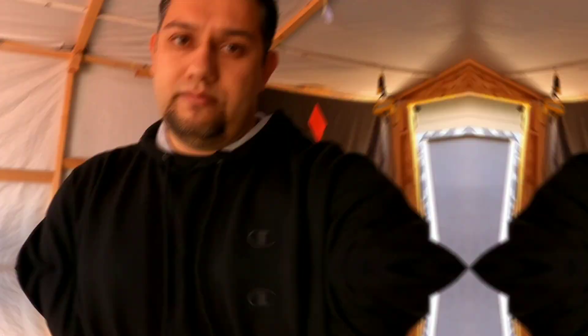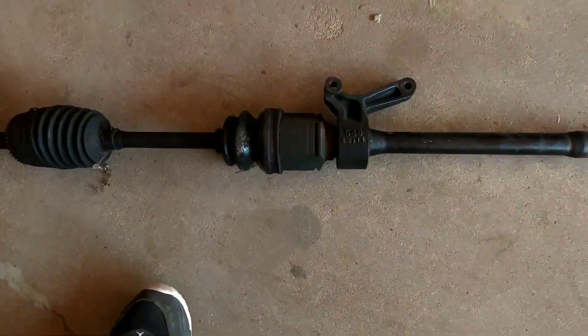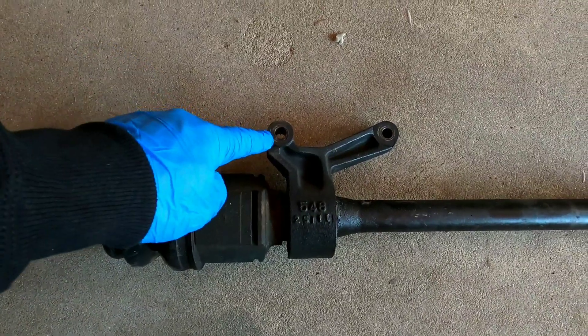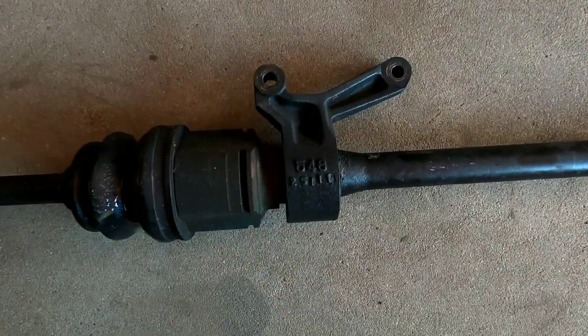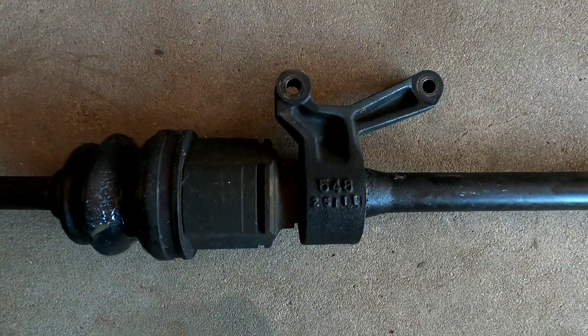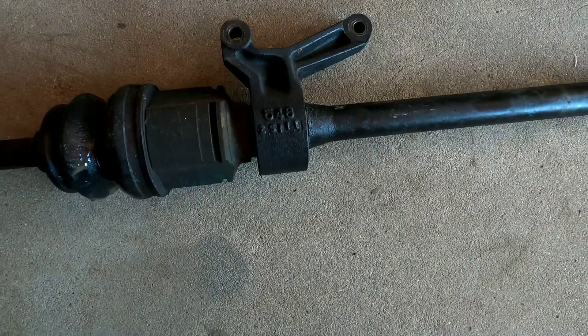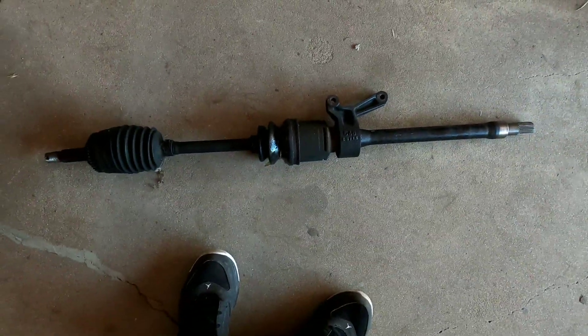One thing I did find out when you do a six bolt swap — at least for the 95s and 96, in my case — I actually had to open up the half shaft holes just a tiny bit with a drill, a bigger drill bit. I'll show you what I mean in just a little bit. What we're looking at is a 2G half shaft axle, driver's side, and these holes here on the 95s and 96 I had to open them up just a tad, maybe the next size up drill bit. That's one way I was able to put the stock axle back into the car.